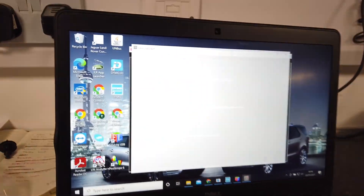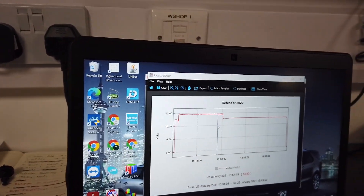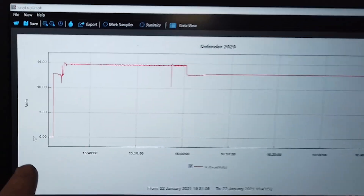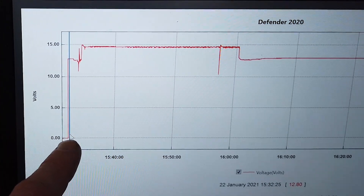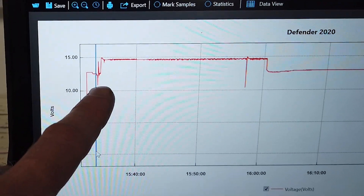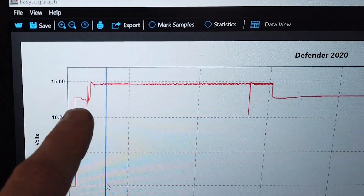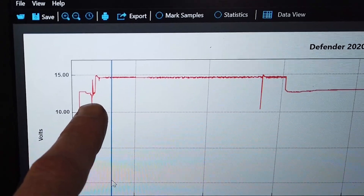Downloading. And then view. So we've got it and we've had a look at it. Basically — I'll try and put this on the screen and highlight the areas. This is zero volts here, then we plugged it into the car. And then where it dips here, this is the voltage dipping — I think due to the fact that the starter motor pulls the voltage down as the current draws.